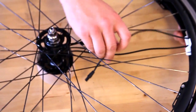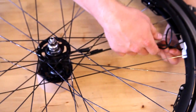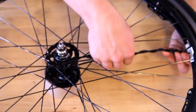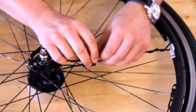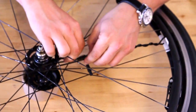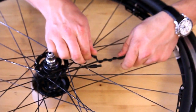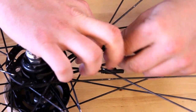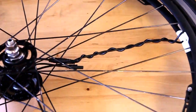You can see there's still a little bit of slack in this W wire, which is totally normal. The next part is to wrap the single wire around it — that will help take up some of that slack. Get it nice and tensioned. When you make the connection, it's important to pay attention to the arrows on the outside. Find the same corresponding arrow on the battery pack, and there's your connection between the W and single wire.